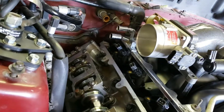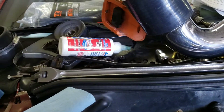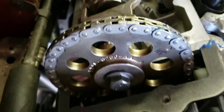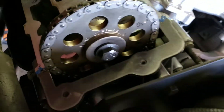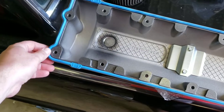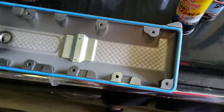Okay, so we're back at the shop. I re-applied some more Lucas Oil assembly lube on all the lobes and everything just to make sure it's not a dry start. I did trim off the RTV squeeze-out. I'm going to put the timing cover on, put two more dabs on there, and then we're going to put the valve cover on. I already pressed the o-ring back in — the Felpro o-ring, which is really nice. Let's get it on.